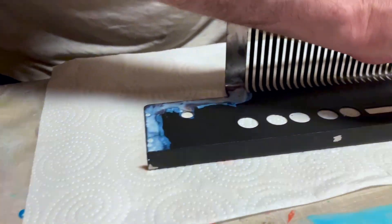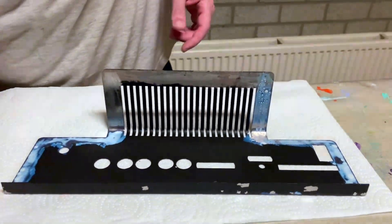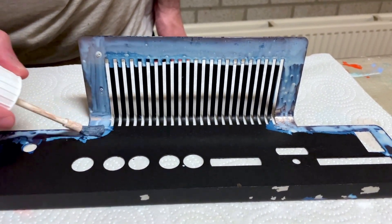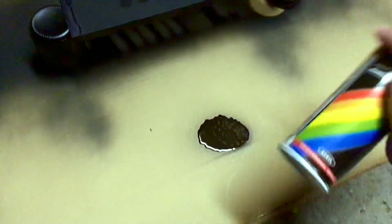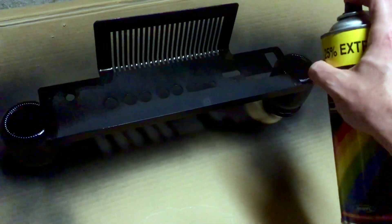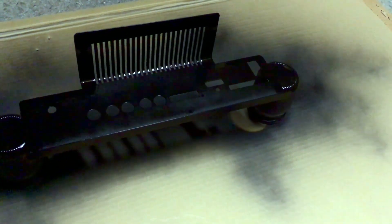After this I'm going to spray both metal pieces with two layers of black primer, two layers of black paint — non-glossy — and finally two layers of varnish, also non-glossy, because originally there was no gloss here. I don't want to add a feature that wasn't there before. Here you see me already spraying the first coats after treatment with the rust converter. I sprayed two relatively thin layers of primer, then two of paint, and two of the varnish as well.